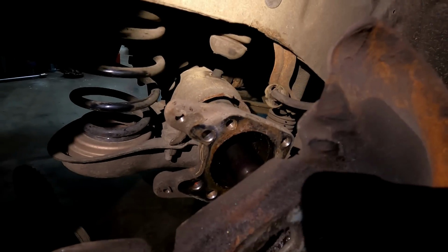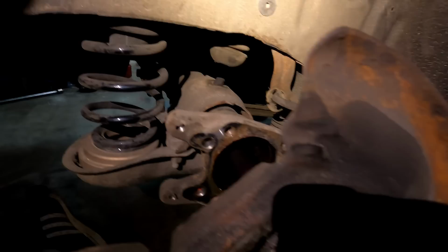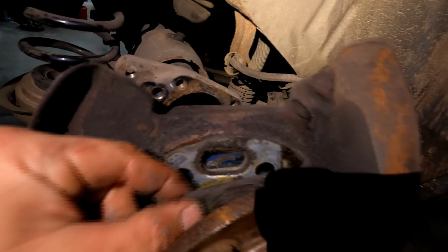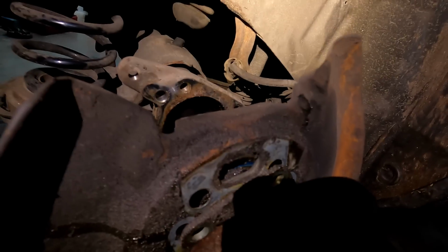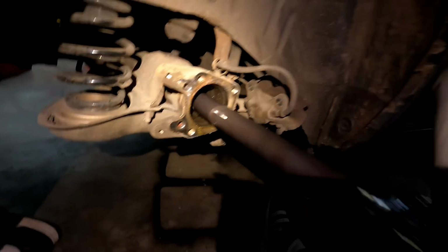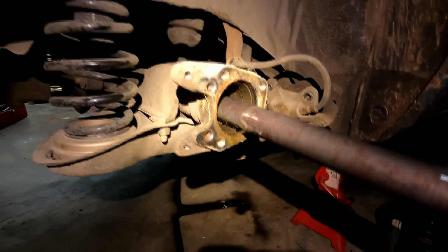All right, guys, so once we've removed our six 14 millimeter bolts, two for the e-brake thing and then four holding the axle in. So there's basically a plate here that clamps and holds the axle into the housing. So what we're gonna wanna do is pull the axle shaft out because this goes completely around it. So we're gonna wanna take that out. So let's just yank this out. There may be some oil popping out, so you might wanna put a tray down there. This one doesn't seem too bad, probably because half of his oil leaked out this seal.